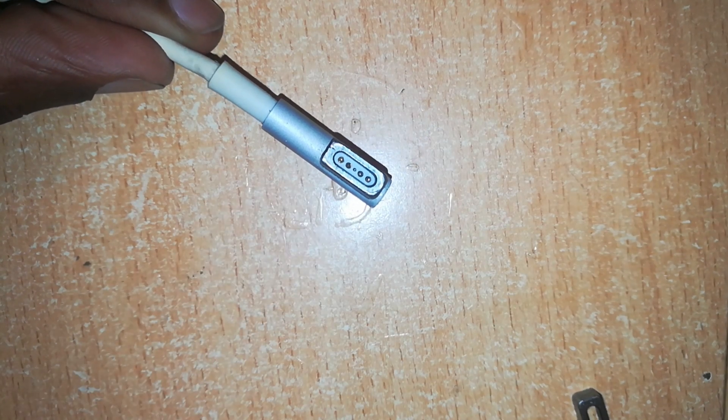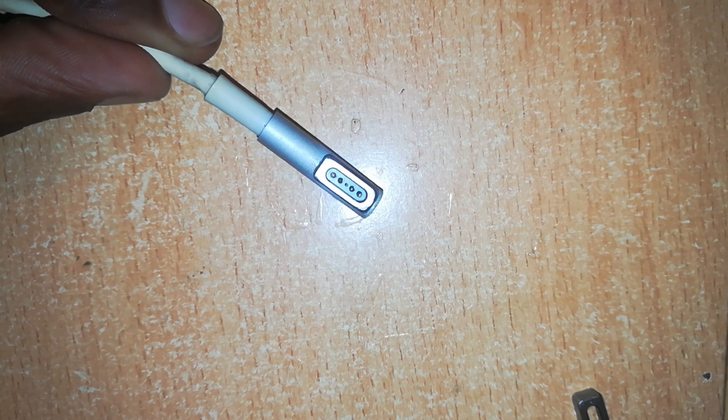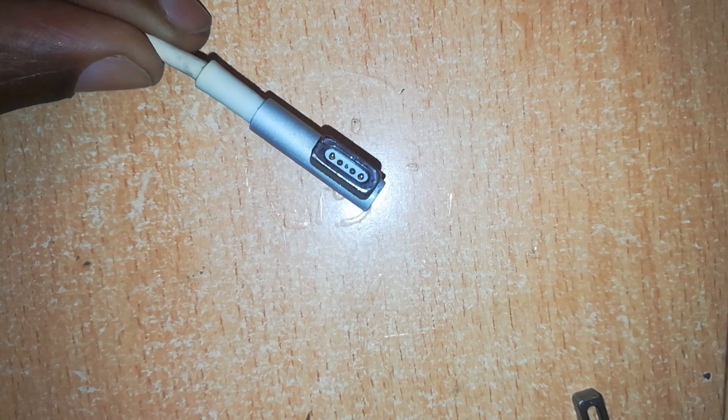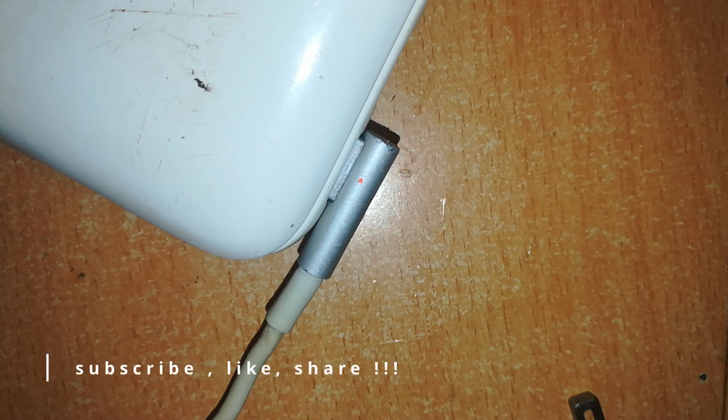After cleaning this area with a razor blade, I've removed the excess glue and tissue paper that was stuck. Now we can confirm if this is working once again. Here's the MacBook — connect it, and you can see it's charging fine. It's green, turning to amber. And that's how you repair your MagSafe charger when you have the pins sunken and also a gouge at this point. It's now having a new lease of life. Thanks for your time — subscribe to the channel if you haven't, give comments, like and share. Thank you.